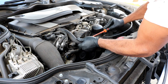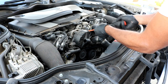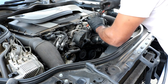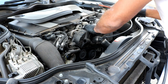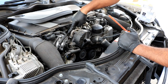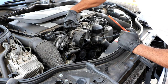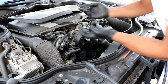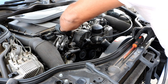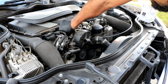The other hose should just pull off - set it to the side. This one here will probably be a little more difficult to get off but you should be able to maneuver it off. Now there is one electrical connector back here. When you're looking at the back of it, just pinch it - like how I am on the back of the pump - and it'll come off. You might need to use a pair of pliers or two fingers to pinch and pull it off.